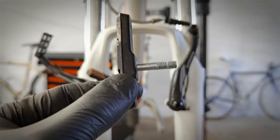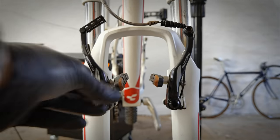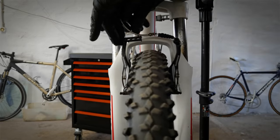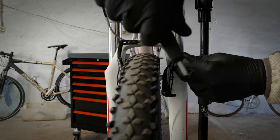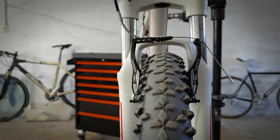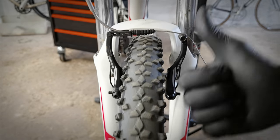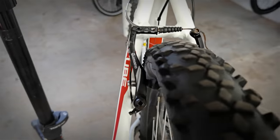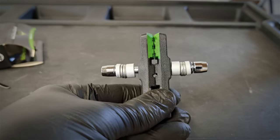See the difference? Let's fix the other one as well, then put the wheel back on. Now we need more slack on the cable, so we readjust the cable. You can already see these arms are much further away from each other, and the braking and modulation is much, much better. Notably, on the rear wheel the right side was correct and the left side was wrong. Here's how the new braking pads will always look.